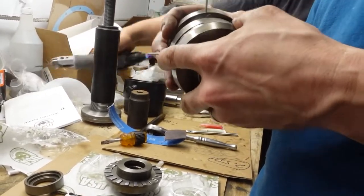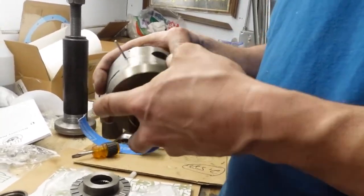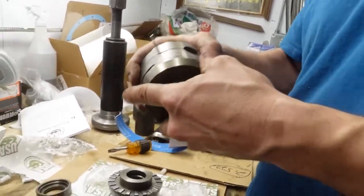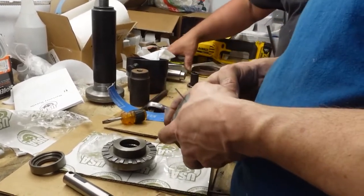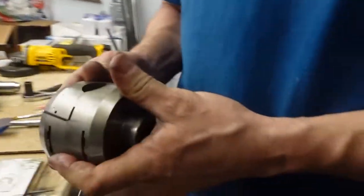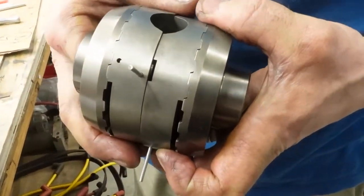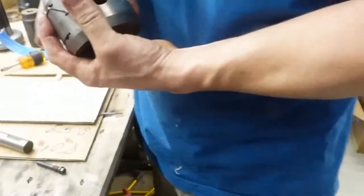This will overcome, because the pinion, the cross shaft is not applying pressure in this grooved area. It's using a cam action here to keep it locked. That's what it's doing when you're under power. It's pulling on the cross pin. That's the whole unit together. These spread apart and lock your C-clips in, and then the pinion goes through and holds them over the cross shaft.